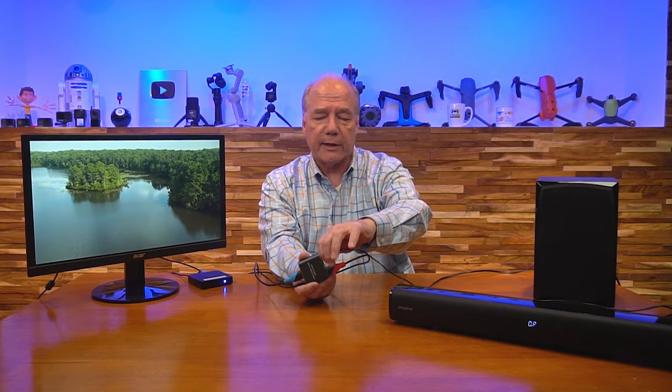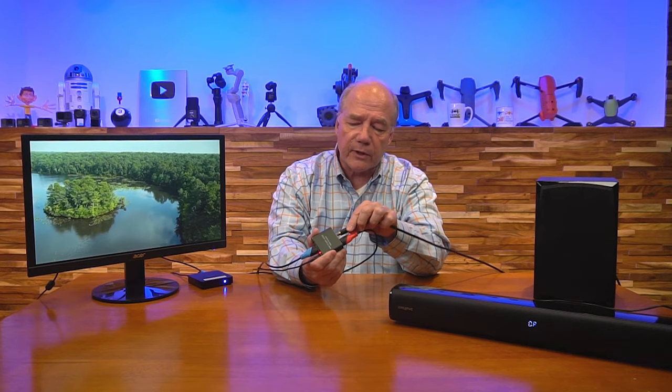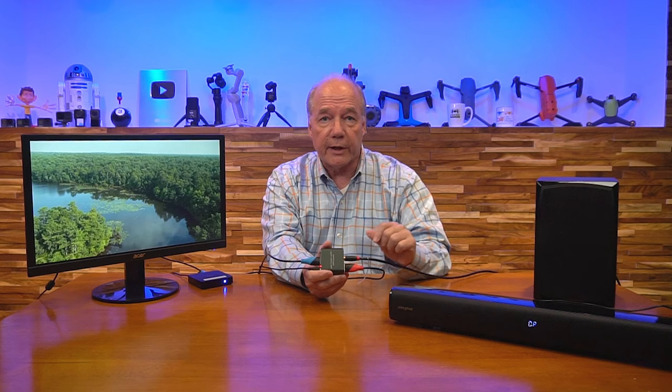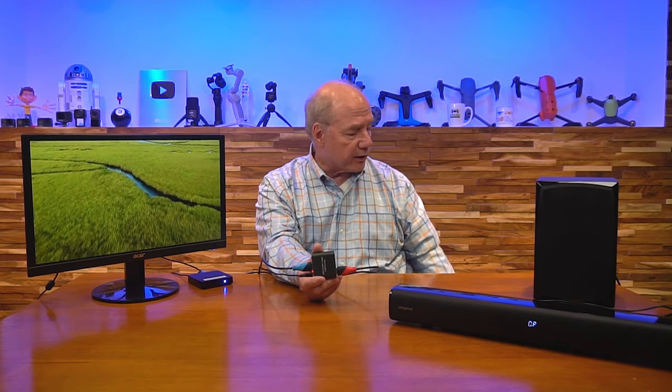Now let's try the optical. I'll disconnect the analog and connect up the digital soundbar — I've got an SPDIF connection and I'll plug that into the SPDIF port. And there you go. One of the great benefits of this product is that both the analog and digital outputs are available at the same time. So you could have a newer digital soundbar playing and add your older analog stereo simultaneously — if you want music all over the room, you can definitely do it with this adapter.